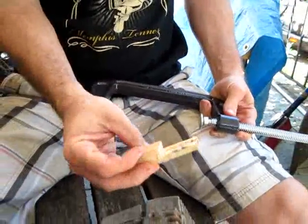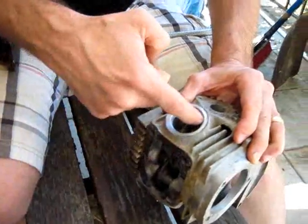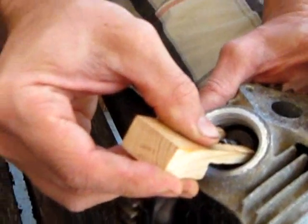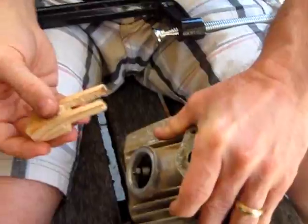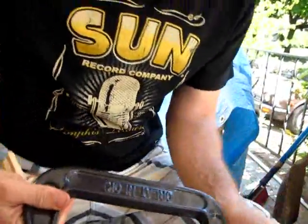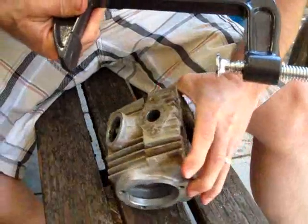What I've come up with is just a nice little vise, big enough to go around the head. I carved out with a handsaw this little piece of wood and made it into a fork shape. Here's the back end of the valve, and here's the spring — just enough to straddle the top of the spring to compress it. You just put the vise on the head itself.